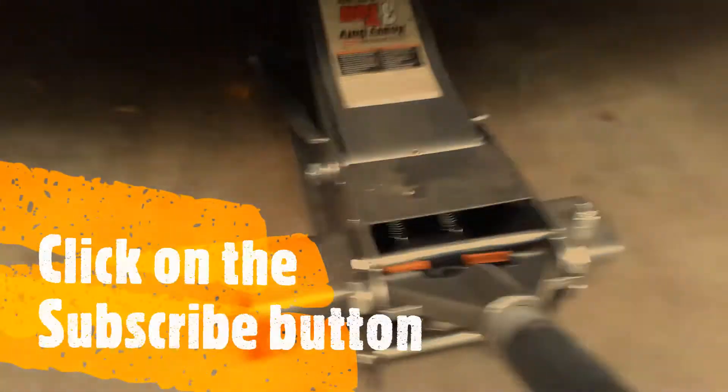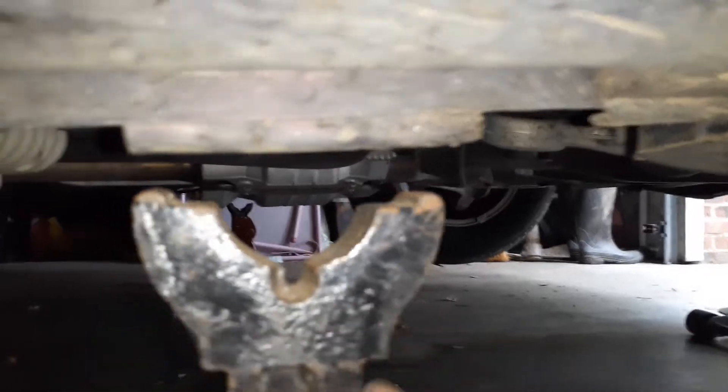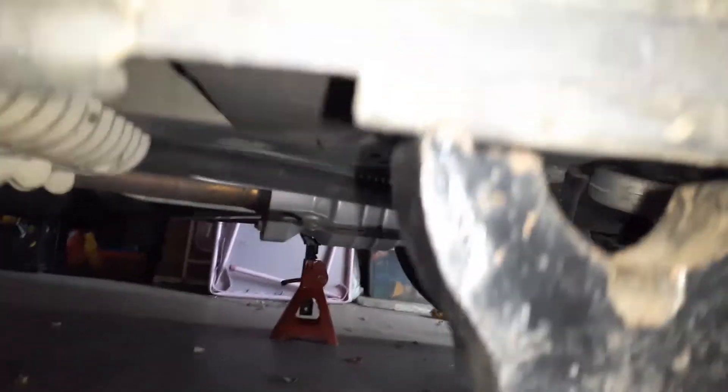This is a three-ton heavy-duty jack from Harbor Freight — you will find the reviews on my channel. I want to raise it up where the wheels are off the ground and then put jack stands underneath. The jacking points are just behind the front tires, one on each side. Make sure you have jack stands holding it and not the jack itself before you get under the car.